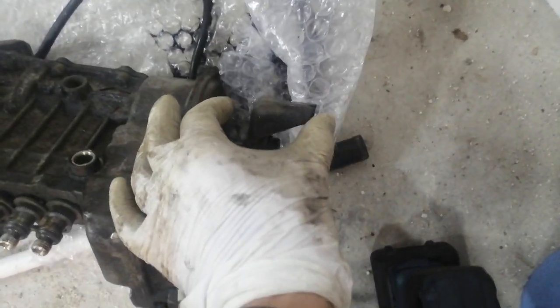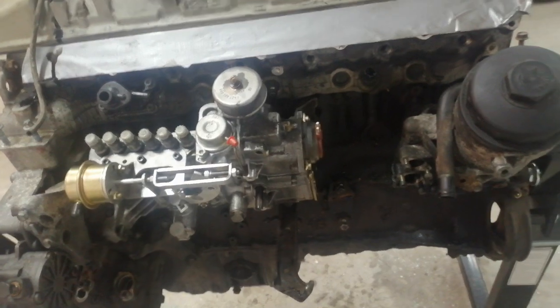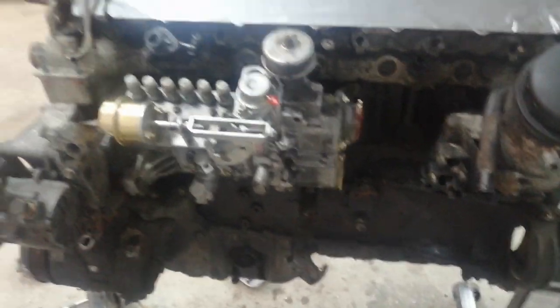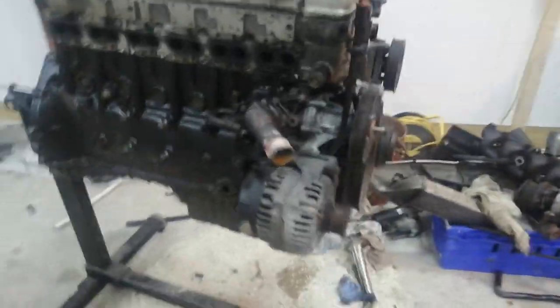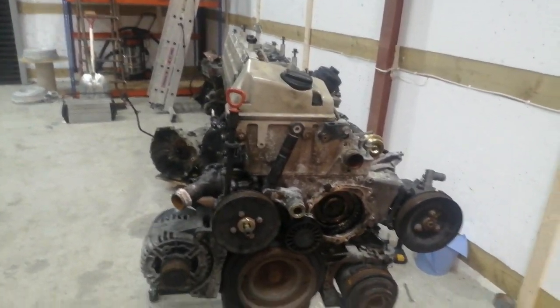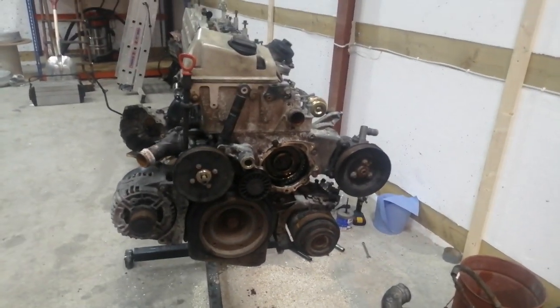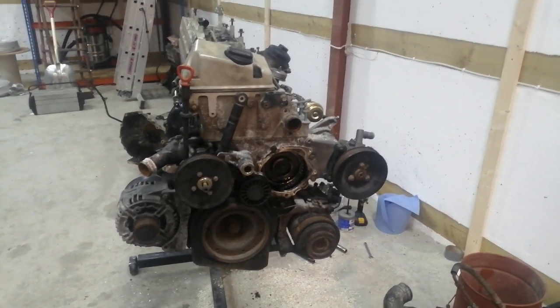What do you guys think about the filter housing — do I just take that bolt out and fit it on, or get an O-ring kit for the old type? The only other thing: because I took this off the other engine, I had the appropriate back mount. If you're doing this yourself at home, there's a sizable difference between the two mounts — the EDC one looks longer this way, while this one is narrower. Just bear that in mind. Thanks for watching — I appreciate all the help. I'm a novice who's really into this but still just having a go and pushing the boat out. Cheers!